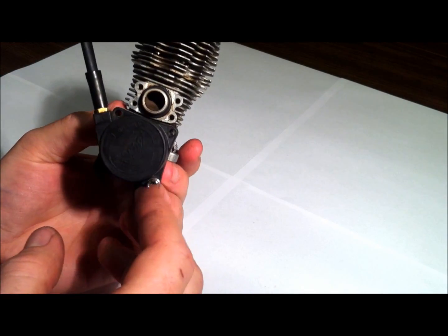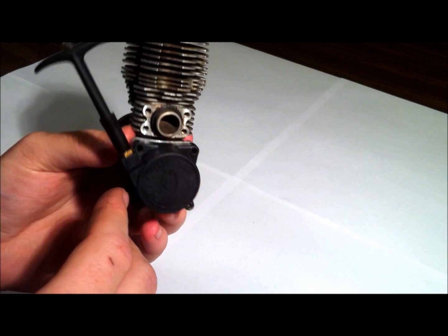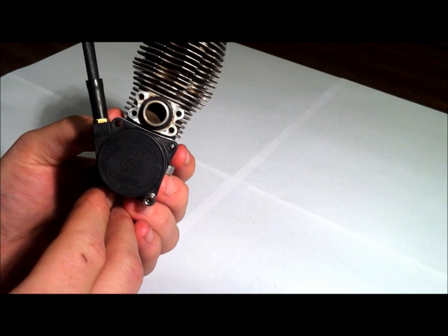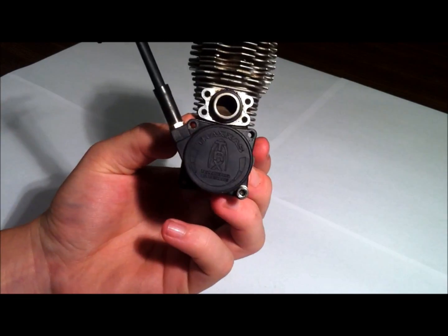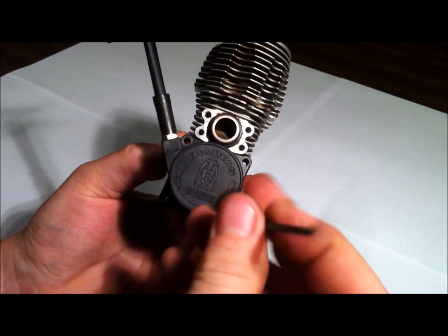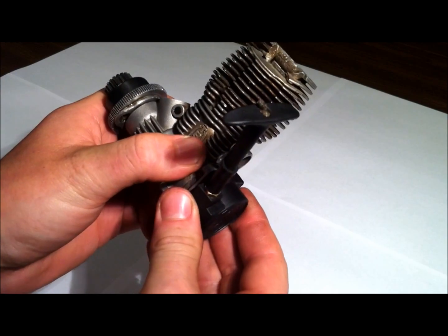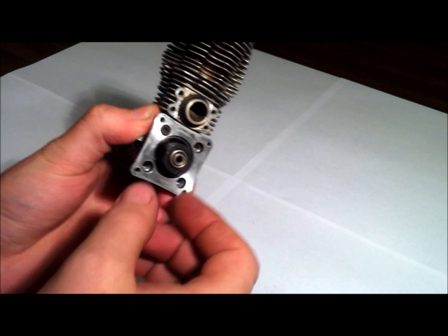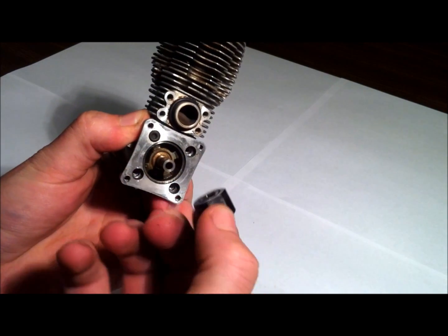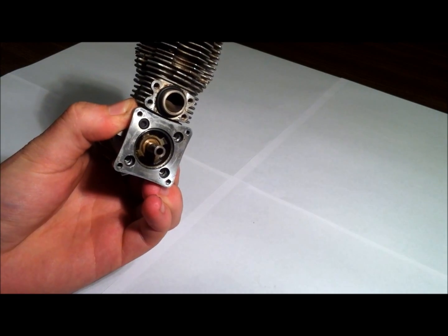Next, I got a pull start and I like it. I know I have other vehicles that have the electric start — they're very nice too — but the pull start works for what it is. There should be four bolts in here, four little screws right there at the corners. I just have one so it doesn't take forever to take them off. Let's take that off and slide it straight off. There's a one-way bearing — it stayed on there. You want to take that off too. Make sure you know which way it goes — it goes one way or the other. Make sure when you take it off, you feel it and see which way it goes.